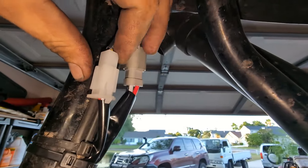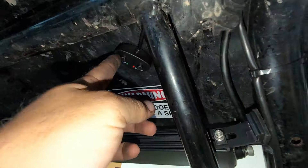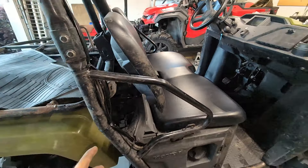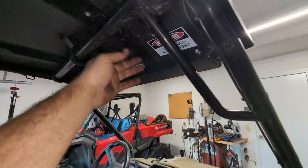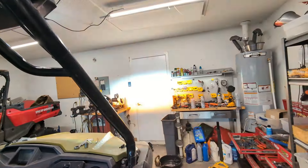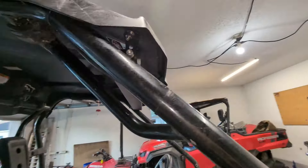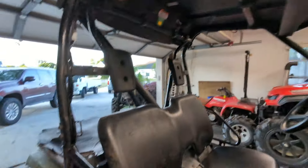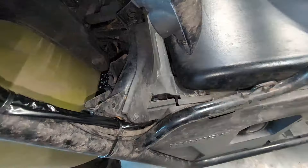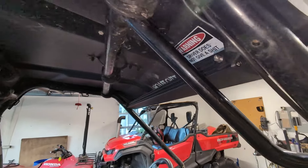This white connector doesn't look as waterproof as the gray one, but this is your remote. I ran the remote back along the main harness. I didn't want more wires in my dash, so I just ran it back along the harness — it's not hard to reach up and touch it in a Pioneer 500. The buttons seem to work good for now, though I don't know how waterproof the button assembly is. We'll test that out thoroughly — this thing will probably go underwater at some point. I'll make another video after a few months with an update on how waterproof the relays and connectors are. If I have issues, I'll probably hardwire it — no relays, just power right up to it with a fuse.